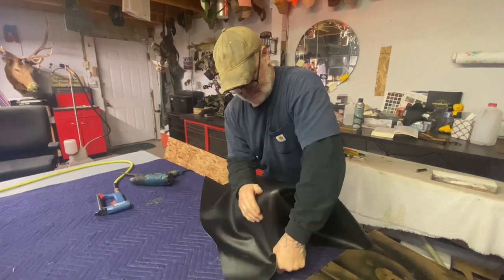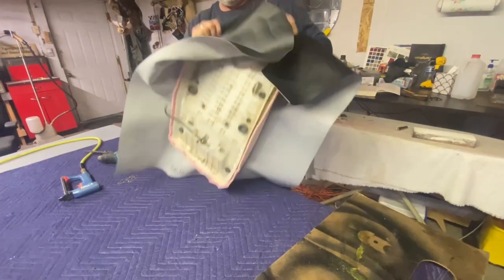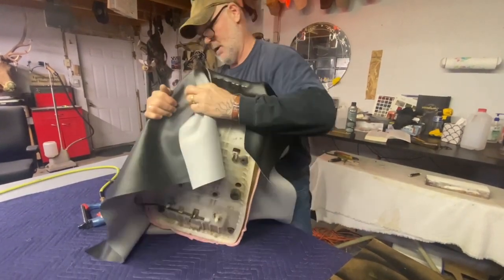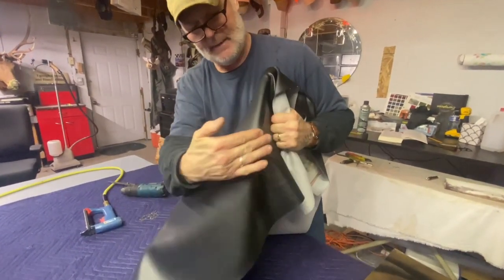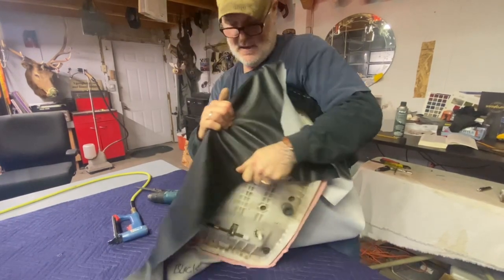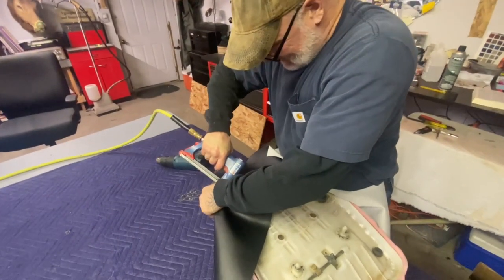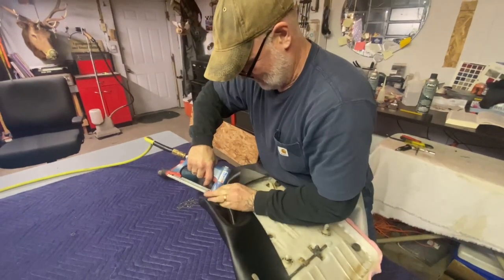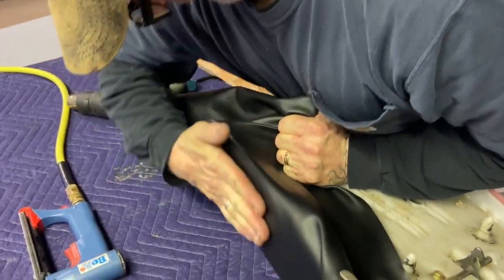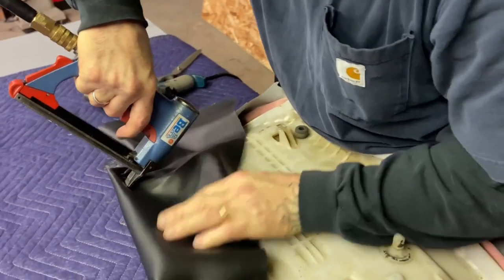See how you pull that side down — see that side gets pulled down, you see that little lip? You pull the sides down first and then you come back and fix this little dog ear last. This is important. Be mindful of what's underneath — you know how far down you're going to staple. Again, we push it out down to that little elbow. Make sure it's all flat. And you've got to remember that you're going towards the back too. I'm happy with that. Pull that up, come back down and give it a pull, give it a tug. Come back down and try to lay your vinyl flat as you go.